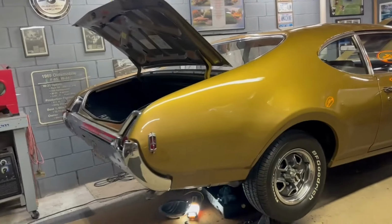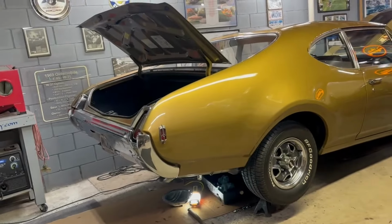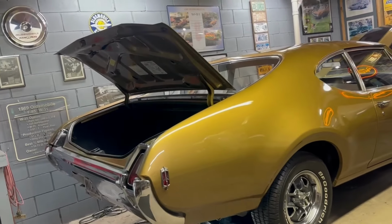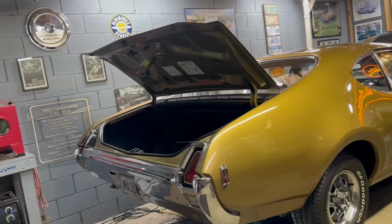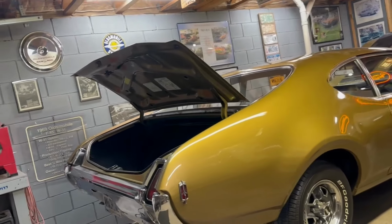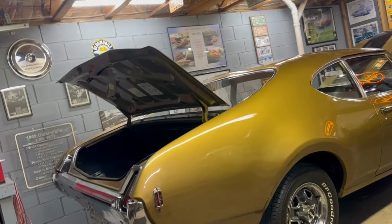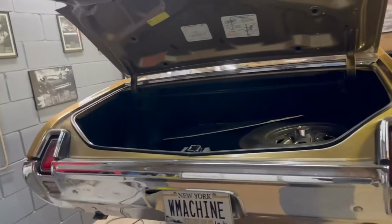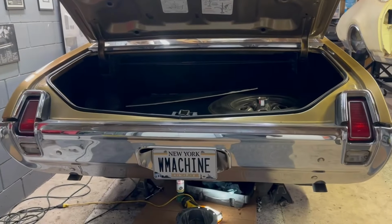Okay, I'll put a new gasket in there. I'll fill it up. I did check to make sure the fill plug could come loose before I took the rear end oil out. How many guys have been burned there, right? You pull the cover off, get the gear oil out, and then you can't get the fill plug off, but this is not a rusty car, so. All right, I'll put this all back together and then get working on the rear axle hose.